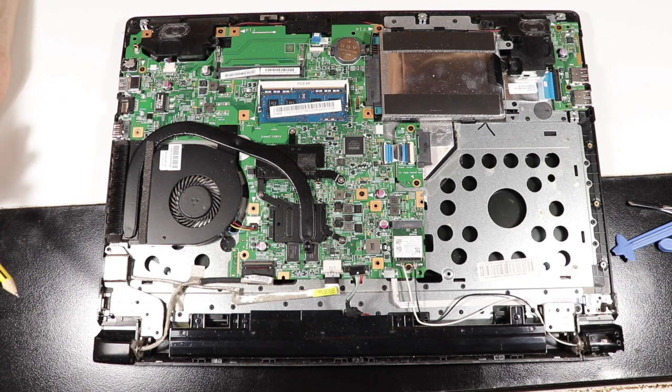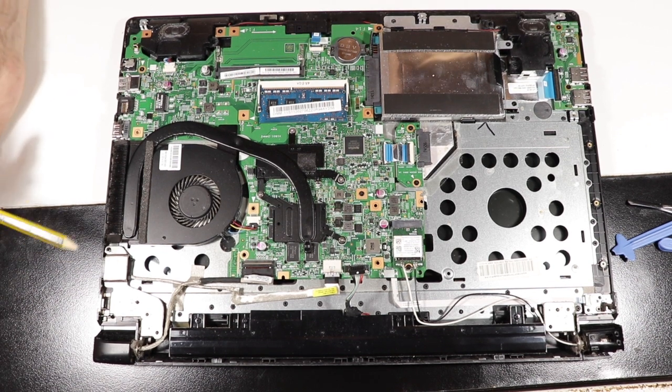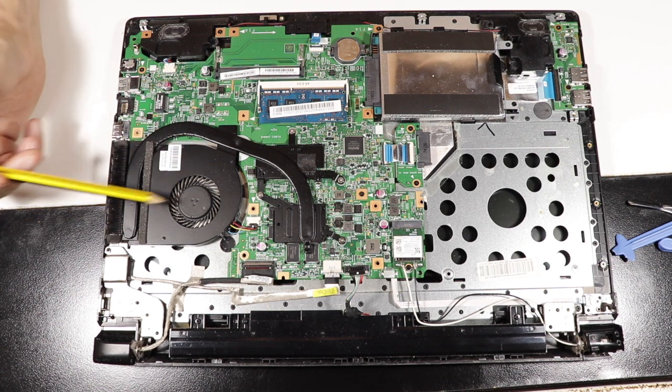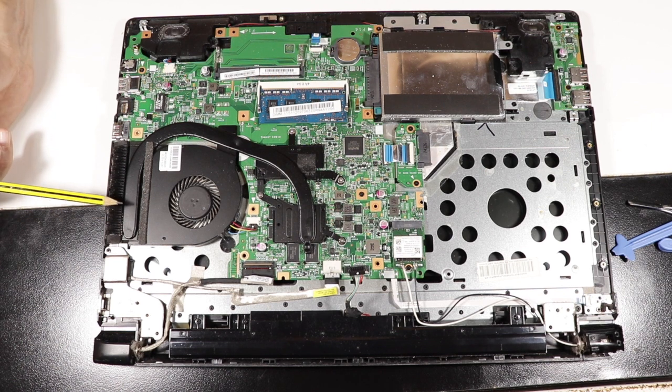So there is always a transfer of heat from here to here and out. Whenever I need to check on a laptop whose screen is dark or malfunctioning, what I usually suspect is that the GPU is sort of fried. With time and usage, this part of the heating sink — the whole system — gets clogged with lint and dust particles.